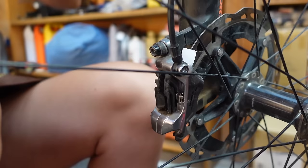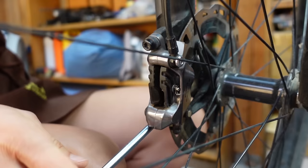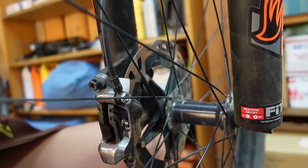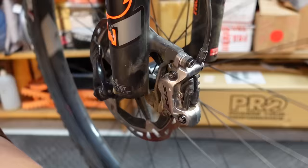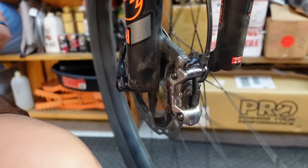Pull the front brake and tighten them back up just like you did previously. This helps create space on both sides because you basically get the width of the paper on each side — that's what you want. Hold the paper as you spin the wheel because that'll help pull it out. Go ahead and pull the brake a couple of times, then spin it. That sounds pretty good — look at this thing, it's still spinning!